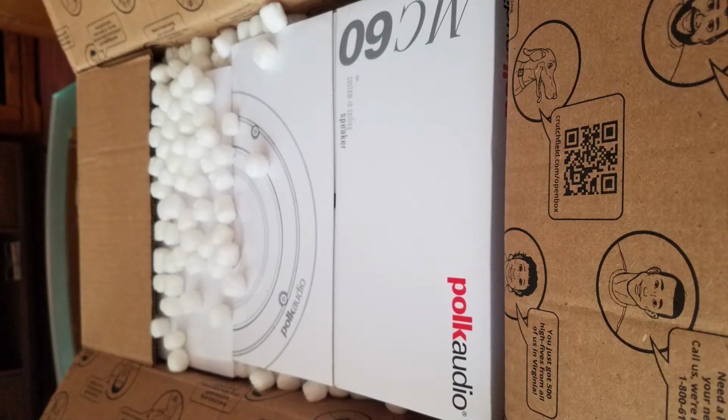So after all of that, I think the only thing I would probably change in this project is the actual material that I used. Instead of using OSB, use MDF. I think you would probably get a better performing speaker using MDF to build your box instead of OSB. One, MDF is a much denser material than OSB. It's actually heavier too. So it'll probably give the speaker much better performance and sound using that material instead of OSB.